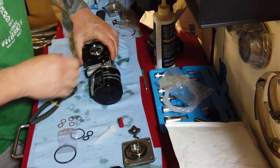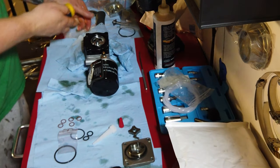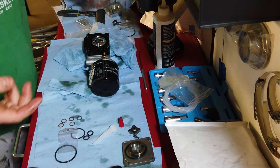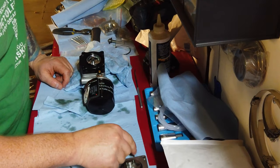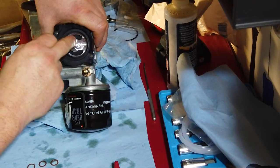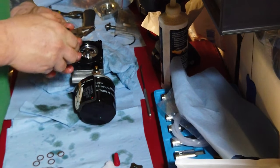Still stiff, but I imagine if I can turn it by hand the engine won't have any trouble — the cam is what drives it, and you don't want to put a huge load through the cam, but turning it by hand is far less than the load it takes to drive the valve springs. Next, we drop another pin back in here. Sometimes you have to turn the shaft until the hole lines up on one of the wider sides and there's room for the pin to go down. It's pretty obvious when you're looking at it, but just a little FYI for anyone working on one of these.